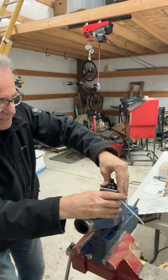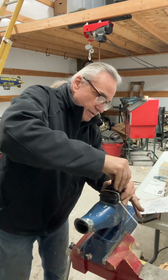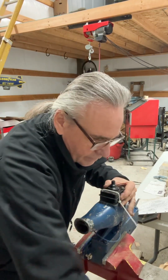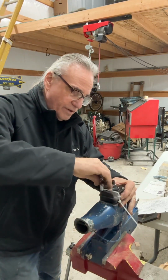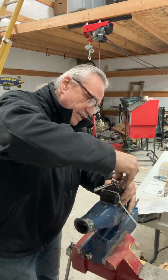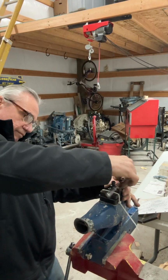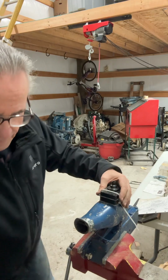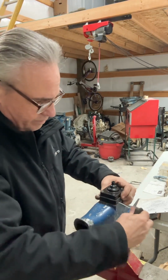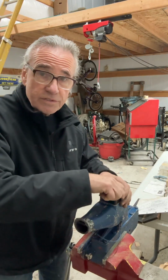And we're going to press down, start our screws. Make sure they're not cross-threading. Get them tight enough so that we know the spring isn't going to bounce this thing across the room, but not so tight that I can't get the wire tie out. All right. Finally, we're going to cut the wire tie, pull that out, put in the rest of our bolts.